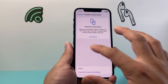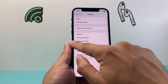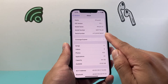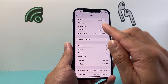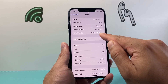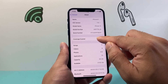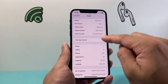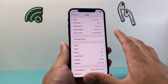If it's still not working after that, go into your settings, then general, then about, and wait on the about page. What we're looking for is to see if there's a carrier update. Sometimes a carrier sends an update, and the only way to update it is by being on this page for about 30 seconds. A menu will pop up if there is an update saying update carrier settings, and you'll click on update. If it doesn't show up, that's fine — it means there's no update available.